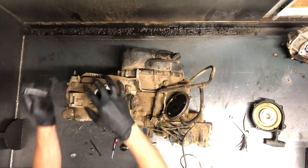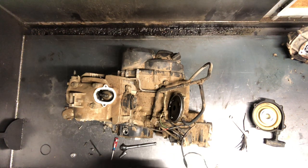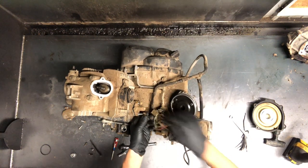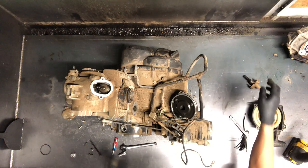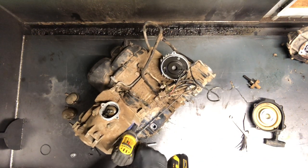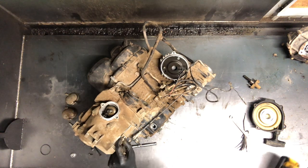First we've got four cylinder head bolts up here, but we're going to go ahead and take off this cam chain tensioner first. It's two 10 millimeters. This motor here is extremely dirty, so if you're doing any kind of maintenance at all, you'll want to do a way better job of cleaning this up. Everything will get cleaned up after it's torn down. You will have to pull this camshaft cover to get to these bolts.